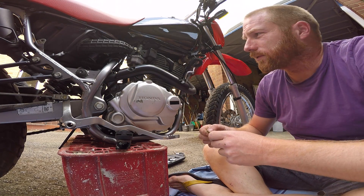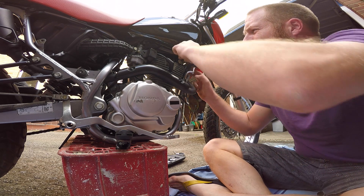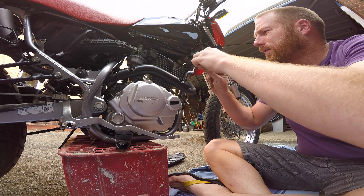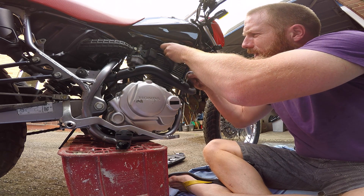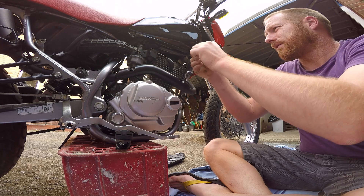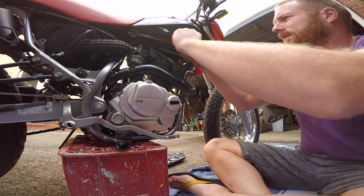So these are the tappet sizes again - doing it in inches. It's 0.003 of an inch in the front - it just wiggles very nicely - and 0.005 for the other one. These two just stick together, so that's right.